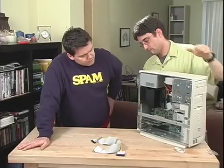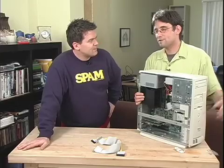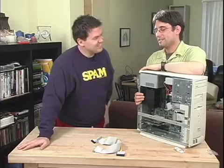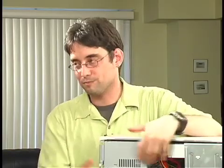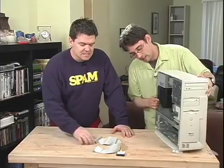We only have a few minutes left — any final words? This isn't for everyone. If you're having no problems with your machine, you may not need to do something like this. But if you're having mysterious reboots, heat may be an issue. It's worth taking a look at a few of these things, because a lot of them are free — just moving cables to the back and moving a card down costs you nothing to try. I don't think my computer will ever look like that inside — I'm just way too disorganized. But for those of you who have the time, the patience, and the money for the $6 cable, it's worth it.